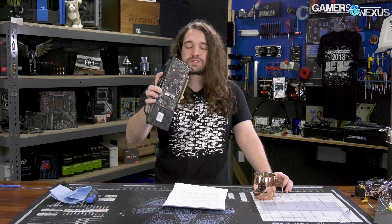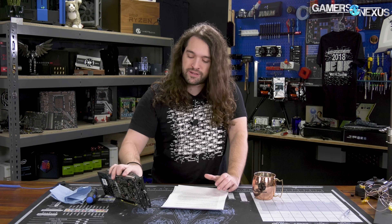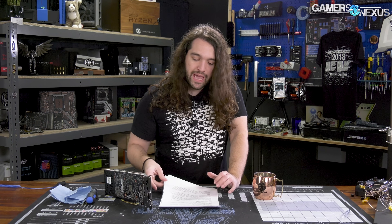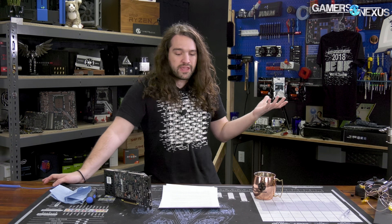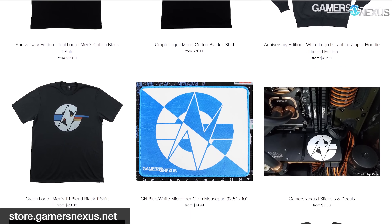On average, the FE is probably a better buy for the money unless you really care about coil whine, zero RPM mode, or easy serviceability — this card is about six screws to get the cooler assembly off and maybe eight more to get the base plate off, so it's pretty trivial. Those are the advantages of EVGA, but just not a strong enough argument to establish a firm reason to buy it at the higher price, which is very unfortunate in this generation. If NVIDIA is going to push their partners to compete with better designs, that's good, but NVIDIA has an unfair advantage since they get the GPU at cost. Subscribe for more, go to patreon.com/gamersnexus to help us out directly, and go to Kyle's channel and accuse him of getting me sick. I'll see you all next time.